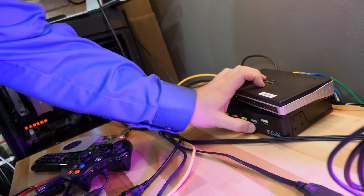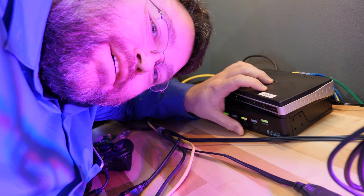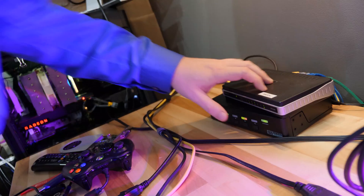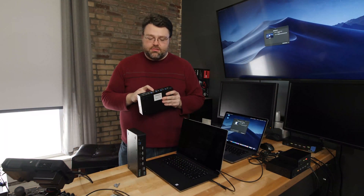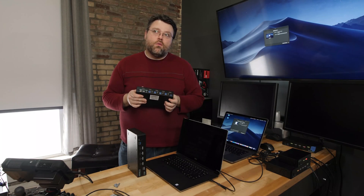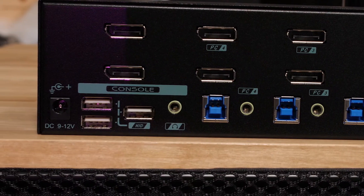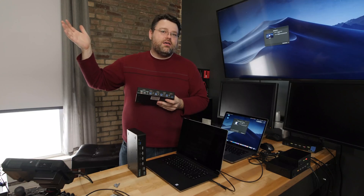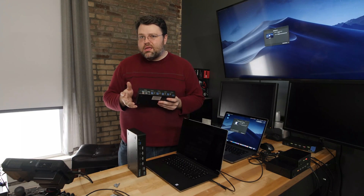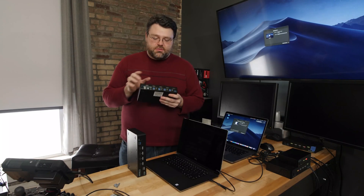It's been over a year since we debuted these. We helped work out the problems with the firmware so that things work a little bit better with higher-end peripherals. We've got USB 3 — competing KVMs only have USB 1.1, which is not great. So we've got a mix of HID ports and USB 3 ports, because depending on what kind of keyboard you have — like if you've got one of the fancy high-end Corsair keyboards, it's not really a HID keyboard, it's a proprietary peripheral — you'll want to use the USB 3 ports for that.